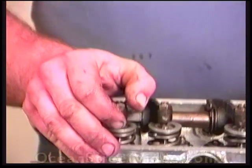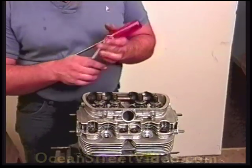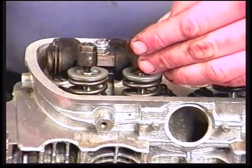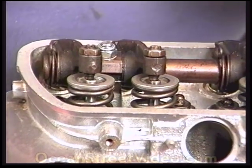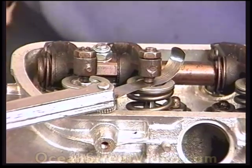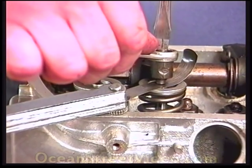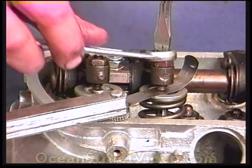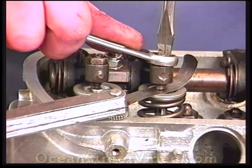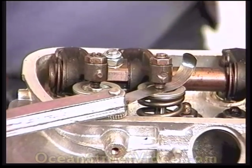The reason you set your valves is it allows your valves to cool up against the seat of the head — that's the space you need. If there was no space, two things would happen: your valves would never cool off, and if they're really tight, you'd be losing compression through the seat of the valve in the head. On a Volkswagen Bug and earlier buses and square backs, all the valves were set at six thousandths. Many cars have a difference between exhaust and intake valve, but this is not so for the Beetle. The four thousandths setting was once recommended, but now everybody uses six because of more heat and cheaper gases causing more expansion. Also, four thousandths has a tendency to close up over time quicker than six.